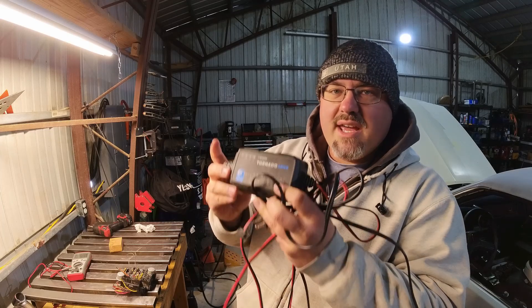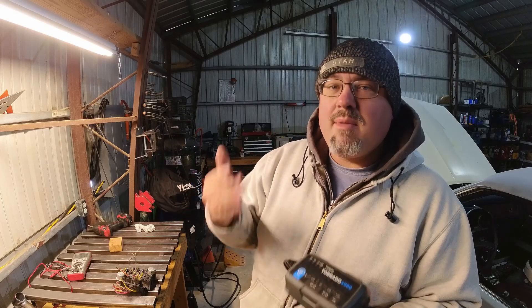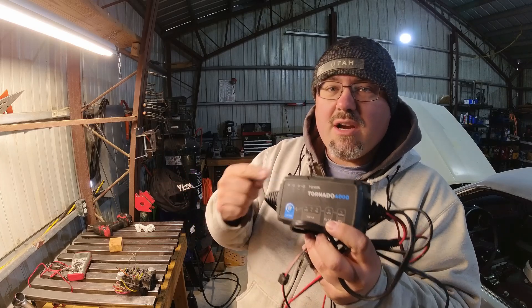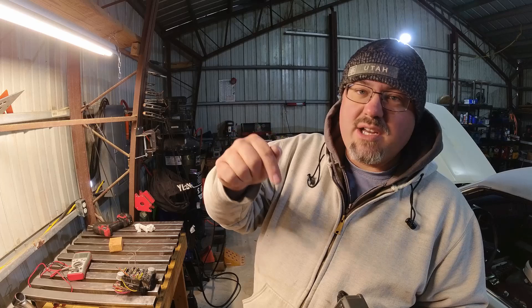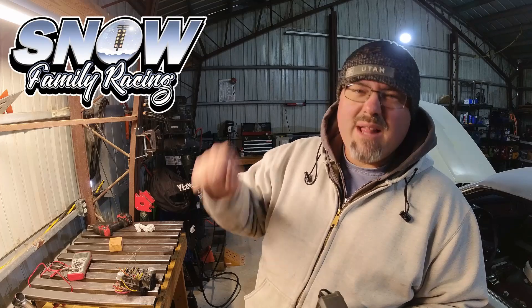A couple of final thoughts: if you're doing electrical testing and doing a lot of key-on, key-off cycling for a long period of time, consider putting a battery charger on your car so your battery doesn't run down and give you inconsistent results. For older stuff a smaller charger will do; for new stuff doing hardcore electrical troubleshooting, sometimes you need a little more amperage. There's also an electrical diagnostic checklist in the description that I use to keep myself focused and following a consistent path. Check that out — I know it'll serve you well. Now let's get out to the garage and go build something cool. Thanks for watching.